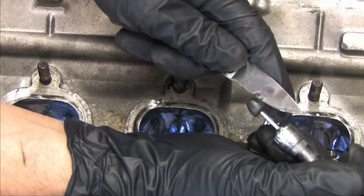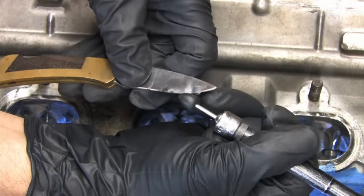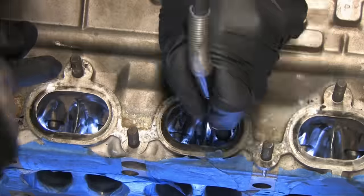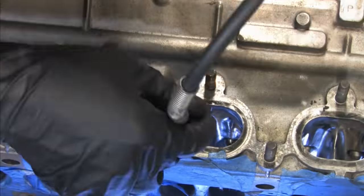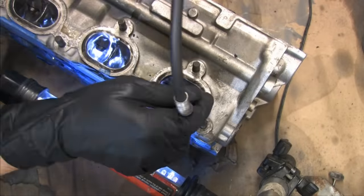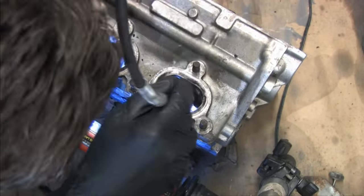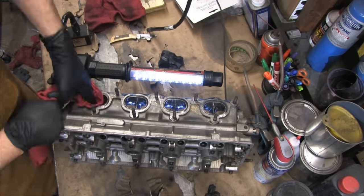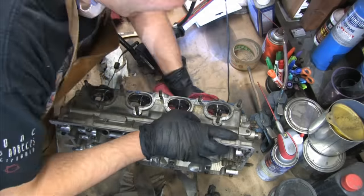But remember that it's the rouge on the wheel that gets the most work done on the rough stuff. Sometimes it gets stubborn and keeps building up no matter what you do. Cleaning the wheel helps in this case. Just when you think you've got it finished, give it another pass. Unlike what you see me doing here, try to use a non-abrasive cloth to wipe up the excess rouge. Then admire your handiwork.